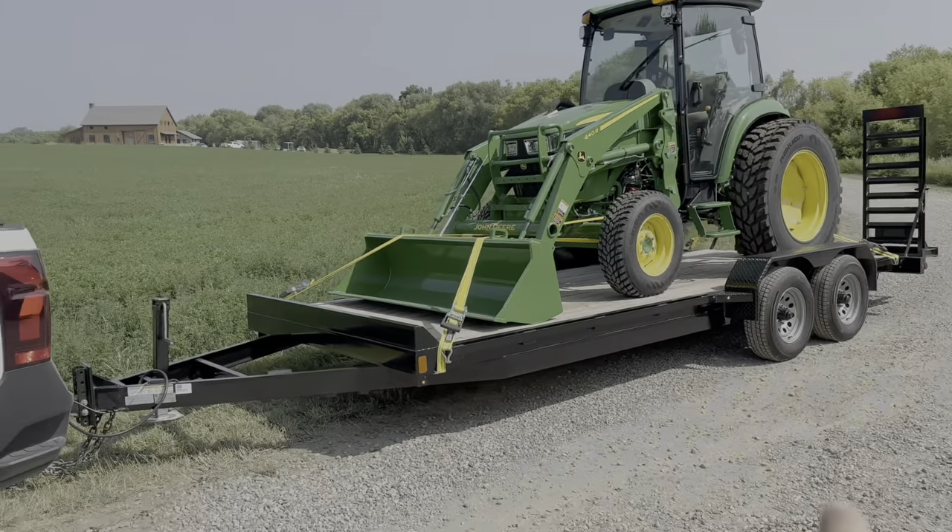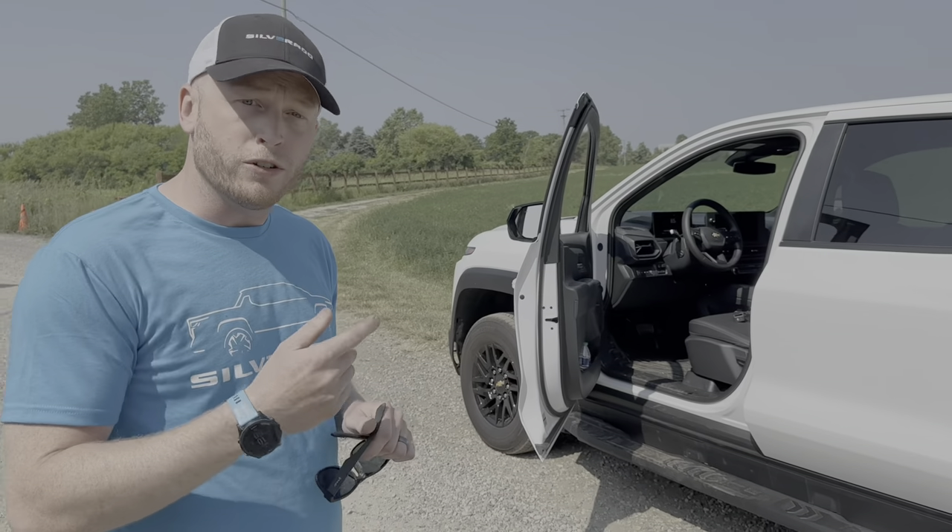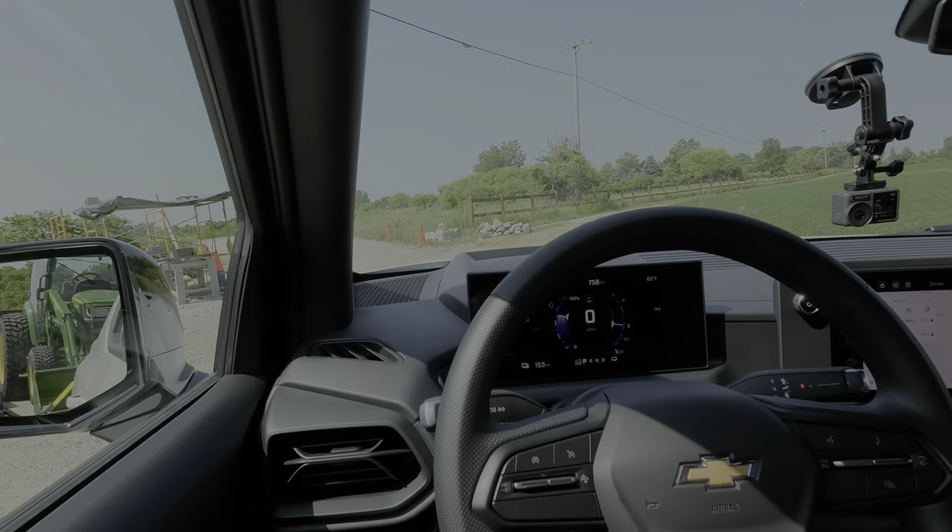The trailer has double brakes in the rear, so it's braked and we can use the integrated trailer brake controller. Inside the Silverado now, the first thing we discussed was tow haul mode. If you've watched the first drive video, you'll notice hitting that mode drops the estimated mileage significantly — proportionally similar to combustion trucks. In our testing, we always found when tow testing that weight almost doesn't matter as much as aerodynamics. Josh confirms the bigger factor in range decay when towing is really the aero factor. An interesting future test would be comparing the same trailer behind a nice ICE vehicle and an EV.